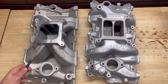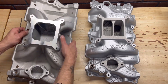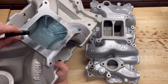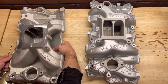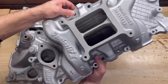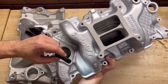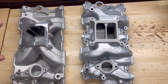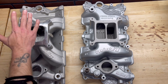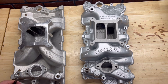The key difference really between the single plane intake manifold and the dual plane manifold lies in their plenum design. A single plane intake manifold has one large plenum with runners that go to the cylinder heads directly — these runners are generally shorter in design. A dual plane intake manifold has two smaller plenums: normally an upper one and a lower one. Those runners are usually spread out to different areas of the intake manifold for the ports, and it is a longer runner design. In short, the main differences lie in the name: single plane has one plenum, dual plane has two. The single plane feeds all cylinders through relatively short, straight, and in some cases equal length runners, while the dual plane has dual plenums — one up top and one lower — through longer runners that route to the intake ports.